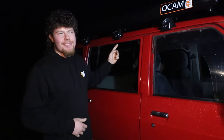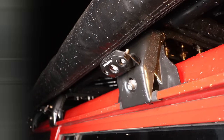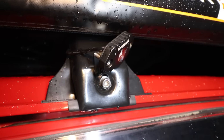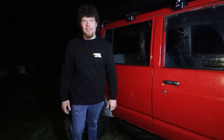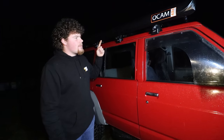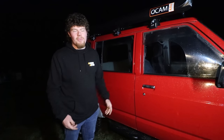I decided to put my rock lights on the roof rack, same as Patrick. But I've done this properly — I made these little angle brackets out of 3mm aluminium sheet, painted black, with a single centre-mount bolt so I can undo it and change the angle. I've currently got the front and rear ones angled at 45 degrees to spread the light wheel to wheel. They make great camping lights and I've tilted them down quite far, so the brightest spot is right beside the car. I've tucked all the wiring in under the roof rack mounts, so it's all pretty well hidden. The wiring feed is currently temporary — once I put a snorkel on, I'll run the wiring down with that since I didn't want to drill holes in the roof.